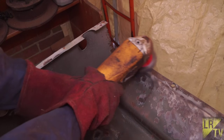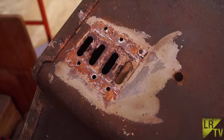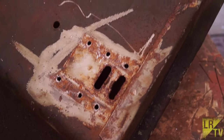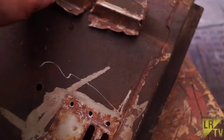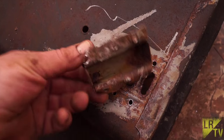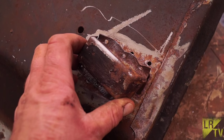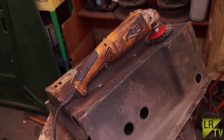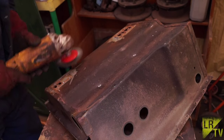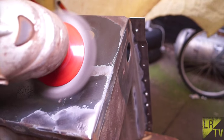This is a very effective consumable. The sections on the battery box that I call breathers — they're spot-welded on, and I just drilled them out with a 6mm drill. They can either be riveted or welded back into place since they're steel. The wire brush on the grinder is very quick for taking off the rust and also the paintwork. I'm finding the rust spots and removing the paint around them, exposing the whole area before treating it with the primer.